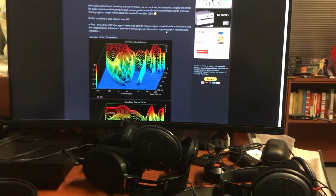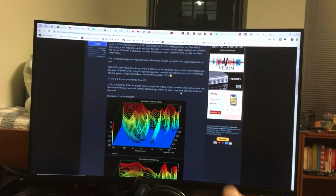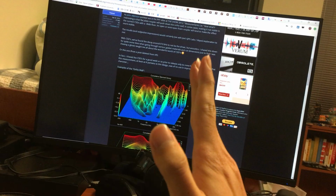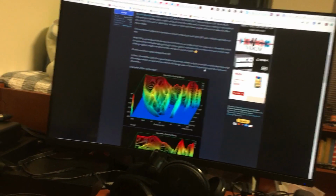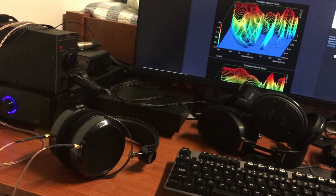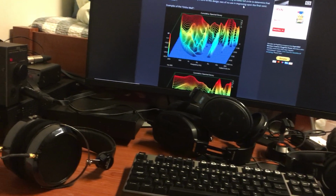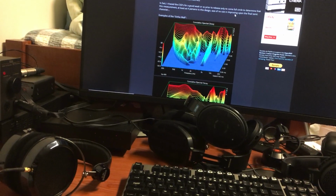As we explained earlier, the lower the tension, the more the driver can travel, but the wonkier the travel will get, and the tighter the tension, the more in control the travel will be, but the less excursion the driver would have, which will result in a drop off in the lowest octave. Now, for the HiFiMan HE6, I would definitely say this issue is persistent despite it being an excellent all-around headphone. It is something you should consider before buying it, since it's definitely not cheap.